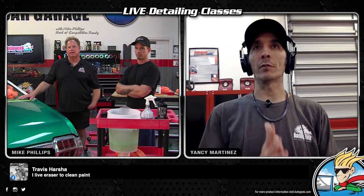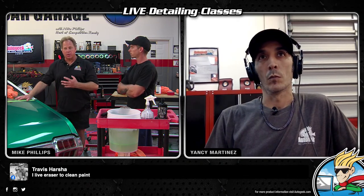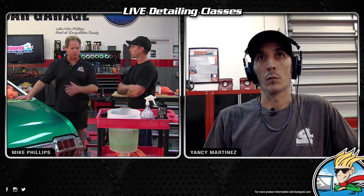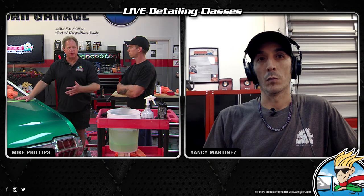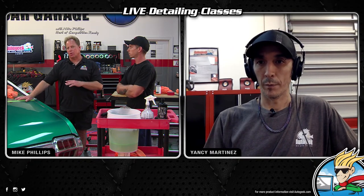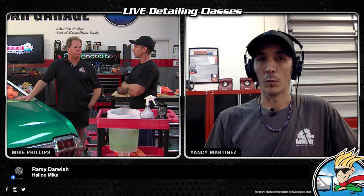Travis, he likes eraser. You use eraser, don't you, for cleaning paint? Yeah, eraser works good, but it's got a lot harsher solvents, and it's less water-based. So for cleaning paint, you still need water. Dirt breaks down with water, and if you just use pure solvent, you'd find out dirt doesn't break down with just a pure solvent. For example, say you just went and bought some mineral spirits to try to wipe down a dirty car. It's not going to feel good because there's not enough water to dissolve normal dirt. So a good prep wash is actually more water-based than solvent-based, and eraser is more solvent-based. So yeah, it'd work, but it wouldn't be my first choice.